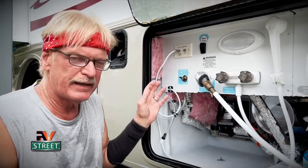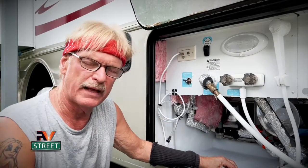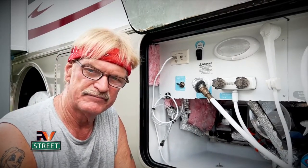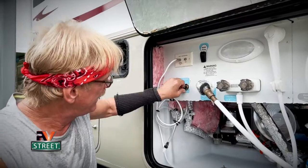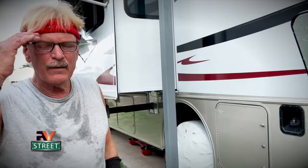But the penetrating fluid didn't work. There are only three things that can cause this pump to do that pulsating. Number one, there's a small leak somewhere in the RV — I checked everywhere and we have no water leaks. The second suspect could be this fill valve, also called a diverter valve. The third and last thing it could be is the check valve in the water pump.